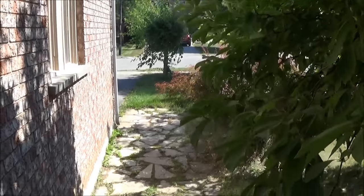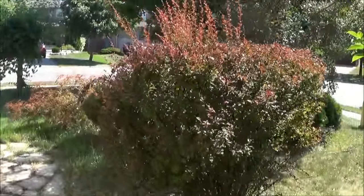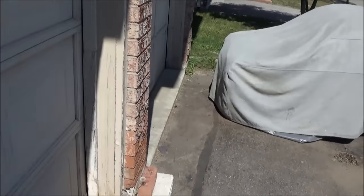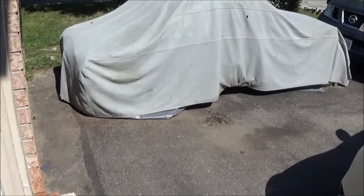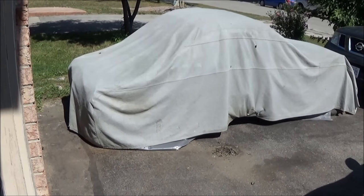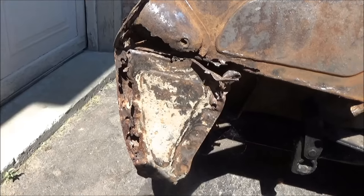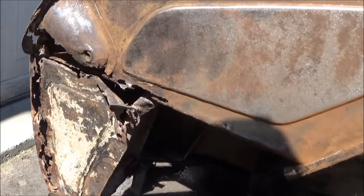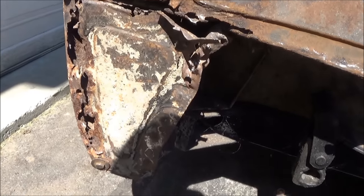It's Labor Day 2016, another gorgeous day — pretty warm. We're not going to get up too much today. I think we'll work on the '59 for a little bit. We'll try to get that rear panel detached. Now that I've got some sharp drill bits, I may just uncover the corner of that and go to town and see how far I can get. Here's where we left off on the '59, just trying to get that closeout panel off. We had a little bit of a start on it but we're going to see if we can continue to drill those spot welds out.